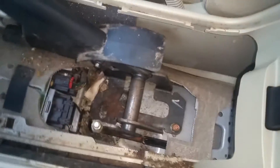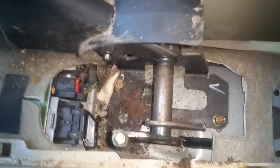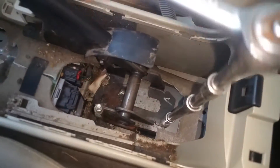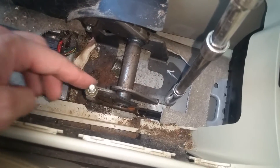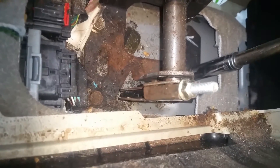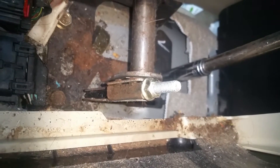This is going to be good — we don't need to fully take this out, we're just trying to get access to those three bolts right there. They look like 13s or 12s, we'll find out in a second. These are 12s. Get yourself an extension, it'll make it easier. We'll also need to loosen this right here, which is what's holding the cable. We'll want to make a mark or count the threads so we tighten it back to exactly where it was.